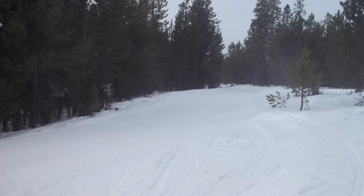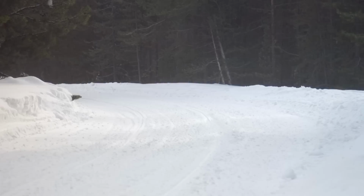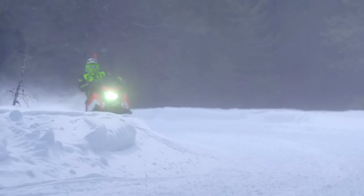We asked Matt if it was inherently harder on a four-stroke engine pulling around an ATV or a side-by-side or a snowmobile. He answered very quickly and said it is tougher on a four-stroke motor pulling a snowmobile around. He made it clear the higher RPM profile that's always in play and the constant load characteristic of all snowmobiles, which don't coast like wheeled vehicles, works an engine much harder. Therefore, the S4 is built stout and strong to handle this extra stress that four-stroke snowmobiling brings to the motor.